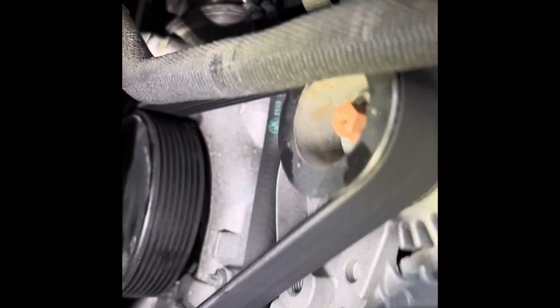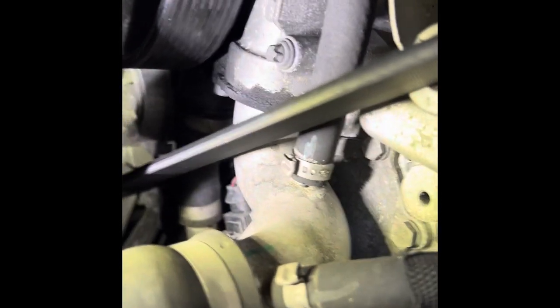With one sensor out of the way as well as the turbo coolant lines, we've got the lower radiator hose right there in the middle and a sensor right above it. Unplugging the sensor is the same way — just a metal clip, press it down and pull the sensor off. The lower hose: just slide that metal retaining clip up and it should slide off as well.